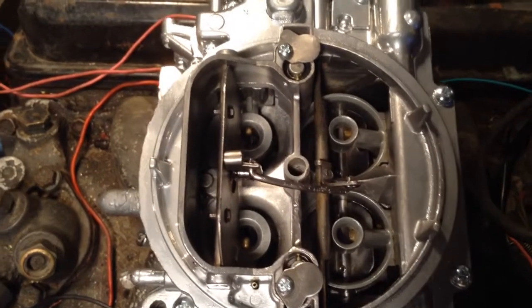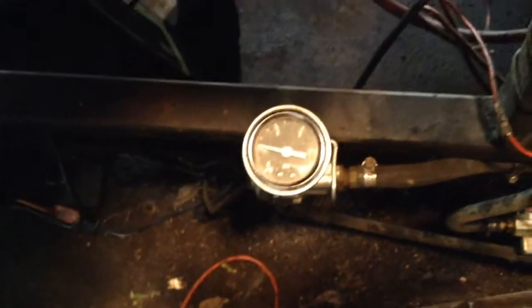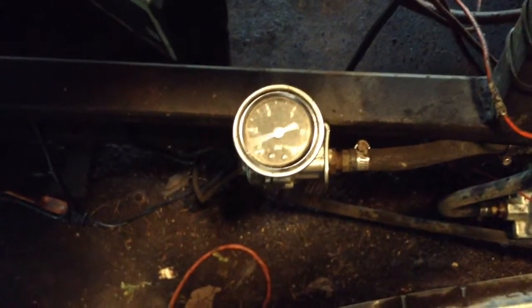You can tell by looking down in there. Fuel pump pressure over here is three pounds — sound like a broken record, but if you don't put it down to three pounds, it'll flood like crazy. Holley regulator. Manual choke, this one is.